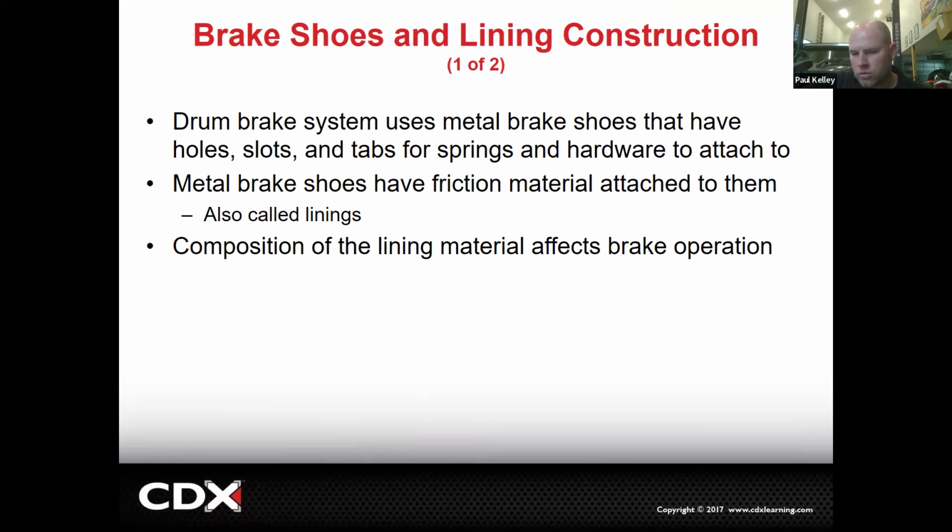And the golden rule, as I've explained already, the golden rule of drum brakes is you work on one side at a time. That way you can walk over to the other side and look. And pictures are good. By all means, take pictures. But in case your picture doesn't get one detail in view, you still want to keep one side apart. You don't rip both sides apart and then try to assemble both sides. You will probably have to reference that. I would even reference it, and I've done a lot of brake work.